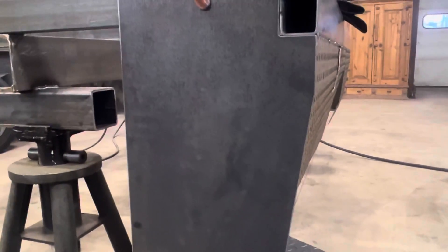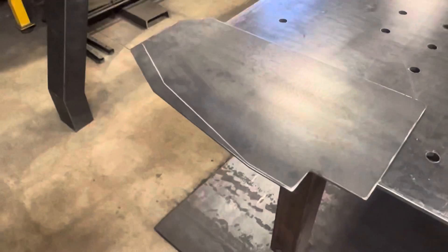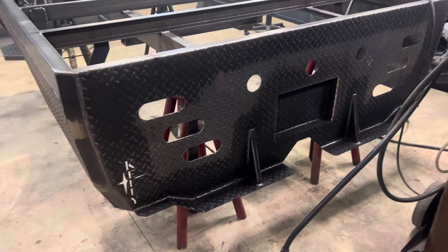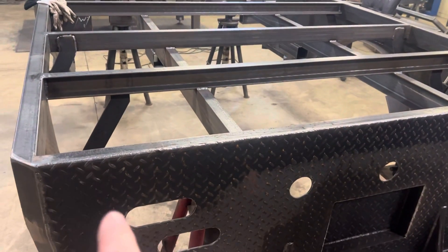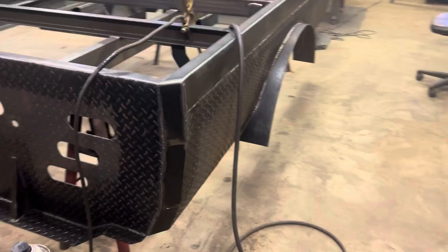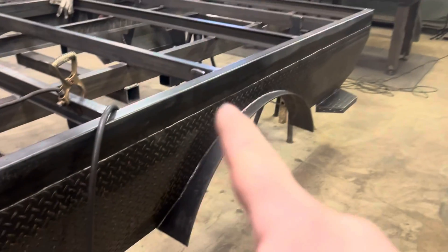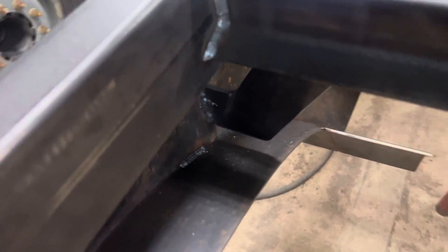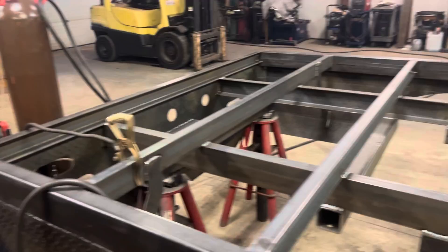The actual bent part goes to the cab, so now that we have that, all you have to do is cut that line and these can be welded on and the supports can be added. Back here pretty much everything's welded — the top's welded and then it'll get welded again when I put the floor down. Over here we welded up the seam all the way down and then the seam on the fender, and just like the back side, just stitch-welded it. Other than that, that's pretty much where we're at.